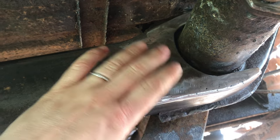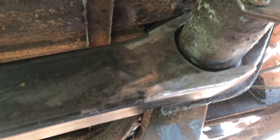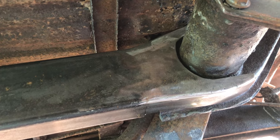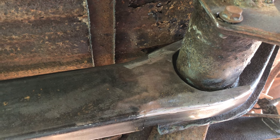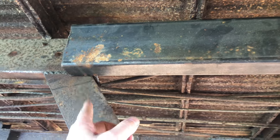Ideally, I would have wanted to butt weld here just because of the aesthetic of it, but since it's bad within about two inches of the torsion tube, I wanted to go ahead and lap weld it over and marry those two together the best I could. So we made this piece and I've cut it a little long in the tooth so that I can bang on it with a hammer so we can get it kind of up close. I'll make a mark where it needs to be and then we'll fit that piece in.